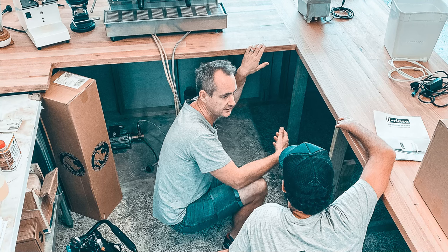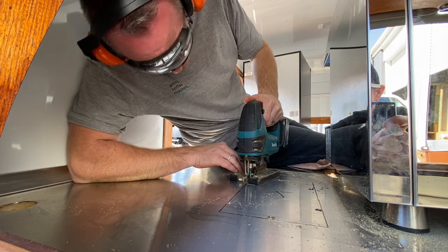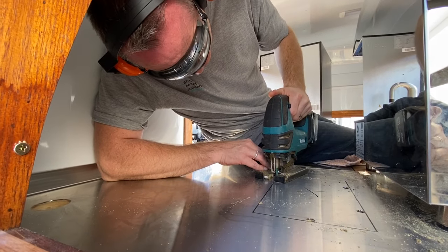Don't forget that a two-group coffee machine is already quite heavy. A three-group coffee machine can be anywhere upwards from 50 to 60 kilos, so make sure you've built your bench sturdy and strong and ready to hold the weight. If you're in a restaurant scenario doing a lot of dining, some people like the size of the machine purely for the cup warmer. If you're doing takeaway cups it's not such a big deal, but if you do need that cup warmer on top, that is maybe a reason the size is important to you. Just keep in mind that if you want to move from a two-group to a three-group in the future, you might be drilling holes in your benches and cutting holes out for your jug rinser, which is going to cause issues when you switch.